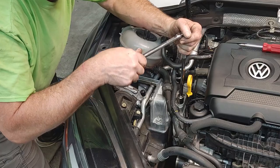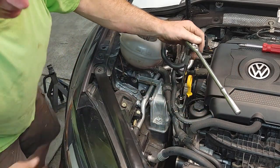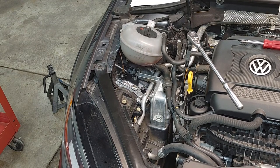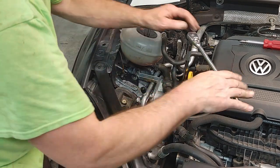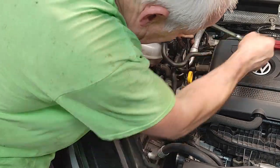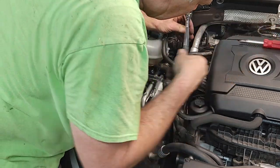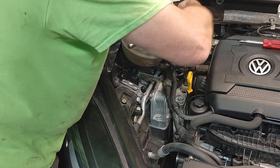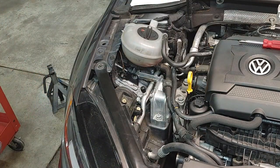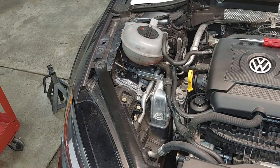And the same thing's going to happen when I loosen these. It's probably going to drop. Yep. So I'm going to jack it up a little bit more. It's actually raising the car up. And if you look while you're jacking, you can see the motor mount move up a little bit because they're nice and loose now. And again, on this side, we got witness marks, and I'm just going to copy them straight over. Not sure if I'm having to jack that up. I think we're as high as we need to be.